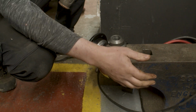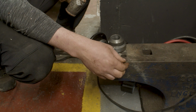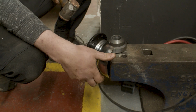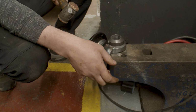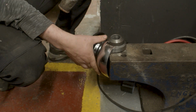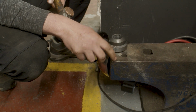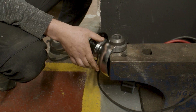Okay, we're lucky. We have a huge anvil here in the workshop, and we can drive this Ralco bushing in. The brilliance about an anvil is the mass of steel underneath it means any blows from the hammer get delivered directly into the material. You would have to be careful using an anvil like this because it could mar up the steel on the other side. Luckily, the inside of these swivel hub housings is not important, and this is a cast iron anvil. It's a very old anvil. It doesn't have a hardened face surface, so it won't mar up the material.